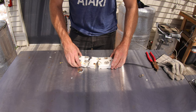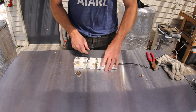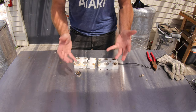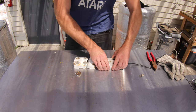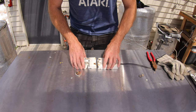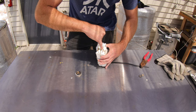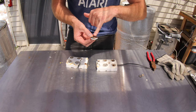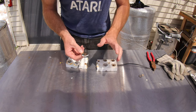So I've broken into this block, and you can see how these are made. They have the circuit board and little piezoelectric transducers, and they must pour some sort of ceramic around it — it comes as a liquid, hardens, and that's an attempt to waterproof them. Now, two of the misting pads on this one had already stopped working before the whole thing failed. I stripped the metal housing off and broke it in half with a hammer. You can actually see rust on the inside where it broke in half. And one of the transducers — the ones that had stopped working — has actually cooked off and is really burnt. So there's obviously been some sort of short which caused that chip to burn itself out.